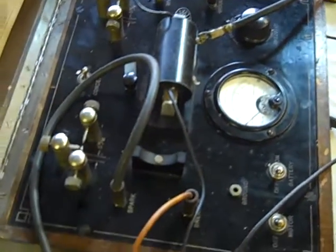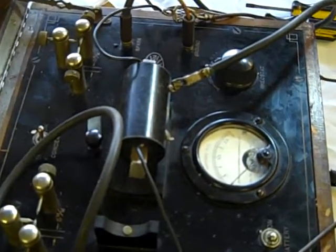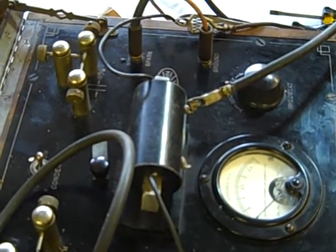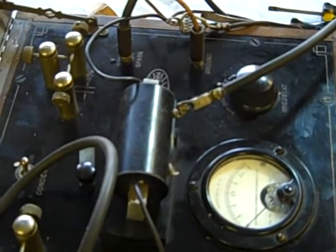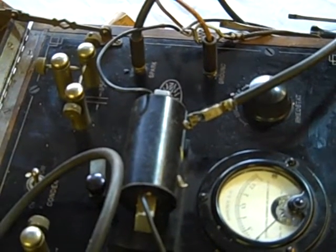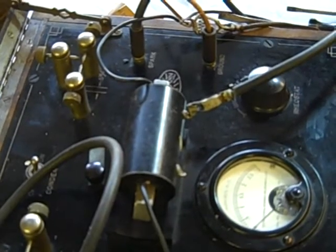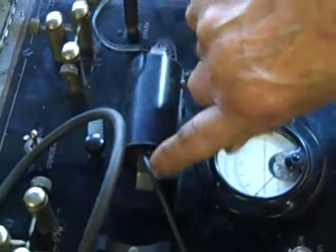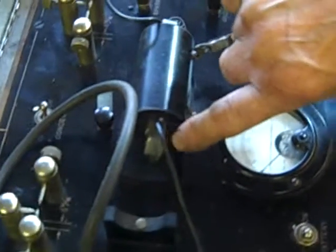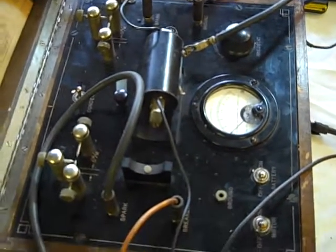In the coil, that winding always has to be around a core. The core is basically a soft metal. When they are put together, that is what they call an E-frame. When they are sandwiched together like that, they are insulated somewhat. That isn't to say they are putting paper between each lamination, but it is the physical property of the soft metal when they stamp these out. You are not supposed to have any grounding between each of the segments or the E-frame segments in themselves — they have to be separated. That's only because they are picking up the magnetic flux from the flywheel, or the magnets.